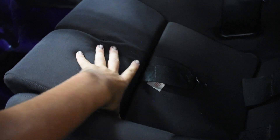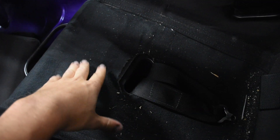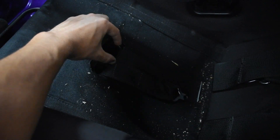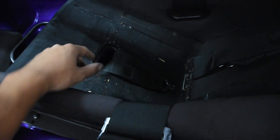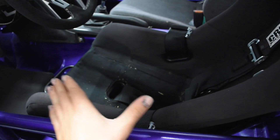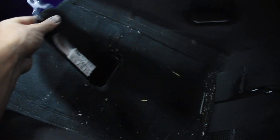In order to install this, we're going to remove the cushion on the seat to make it a little easier. Now that you have the hole exposed in your bucket seat for the anti-submarining belts, what I do is take a paint marker and mark directly downward from the hole, marking the two endpoints so I know exactly where the opening for the anti-submarining belt is in the bucket seat. I also make sure to have my seat in the exact position I would be driving the car in. Based on those marks, I can move on to drilling the holes to mount my harness.